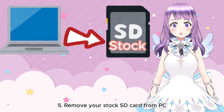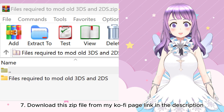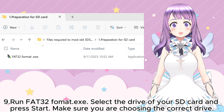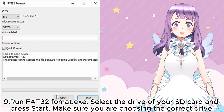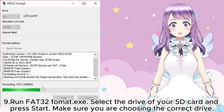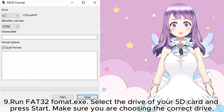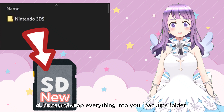Remove your stock SD card from the PC. Insert the SD card you are upgrading to into your PC. Download the files required to mod all 3DS and 2DS from my Ko-fi page in the description box. Unzip it and go to the preparation for SD card folder. Inside, we have fat32format.exe — run it to format your SD card. Make sure to do this if you are using a larger SD card or micro SD card, because 3DS and 2DS only run well on FAT32. Windows does not allow formatting larger cards into FAT32 directly, which is why we use this software. Then drag and drop your backup 3DS folder onto your new SD card.